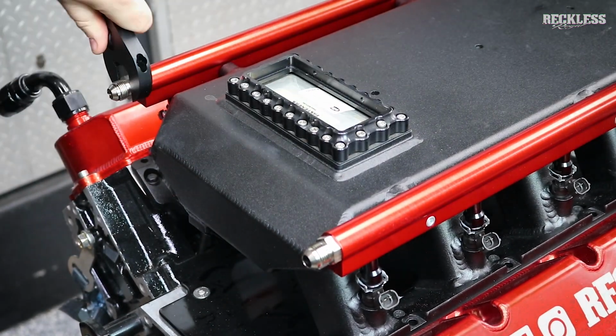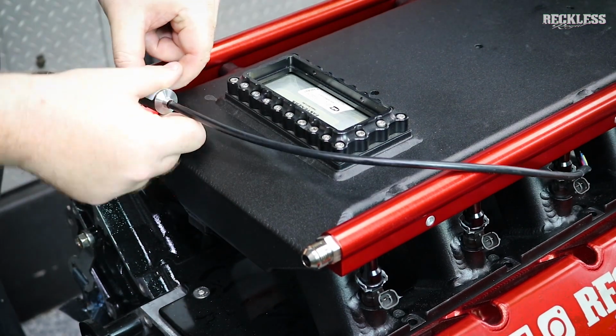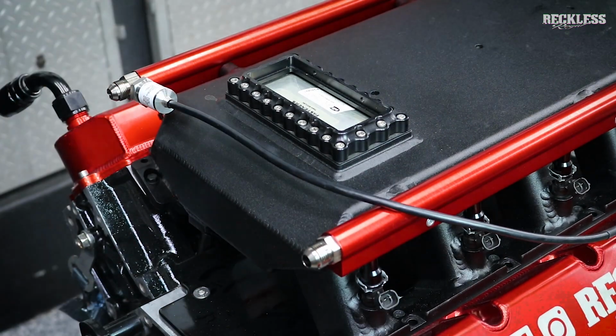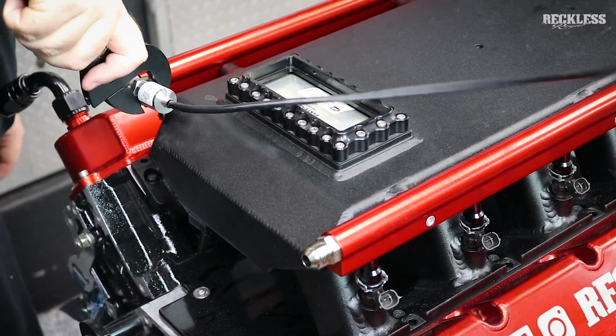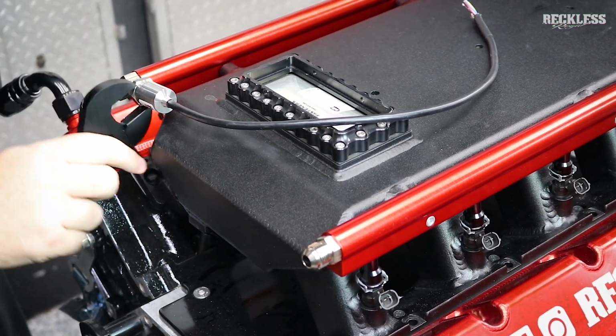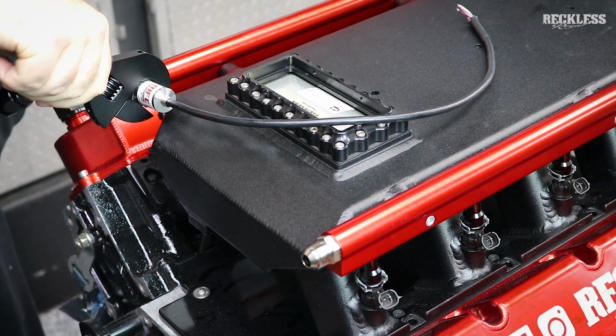It's great footage. So you can see as we build this rear line here, I also have the Rife fuel dual pressure sensor. That is a temperature and pressure sensor in one sending unit. Fuel temperature is a huge deal for your data logs, and a lot of people overlook that.